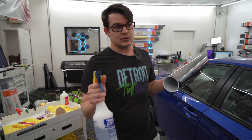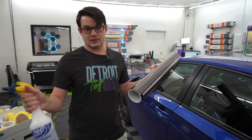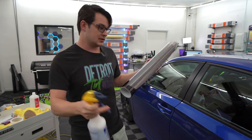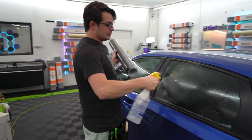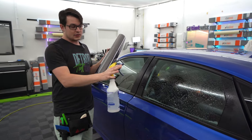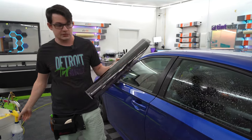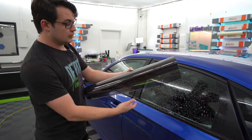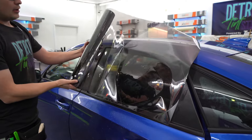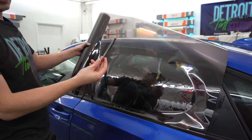The other things you need are a roll of film and a spray bottle. You can use a spritzer bottle, a pump sprayer, or a tint keg — that will be covered in a completely different video. This video is just to highlight the categories of tools you need. Spray the outside of your window, which we've already cleaned — definitely check out that prep video in the description — and then unroll a piece of film onto the glass.